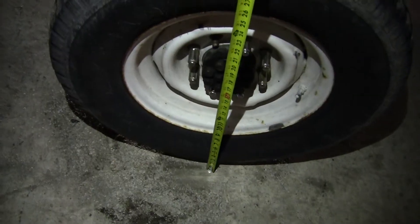I'm gonna take the rear springs off and bring them to the local spring shop to see what they recommend - either getting them re-arched or replacing them. These springs have been patched together; I took them apart, found broken leaves, and just stacked in whatever wasn't broken. I made the truck work for being 17 years old, we'll put it that way.